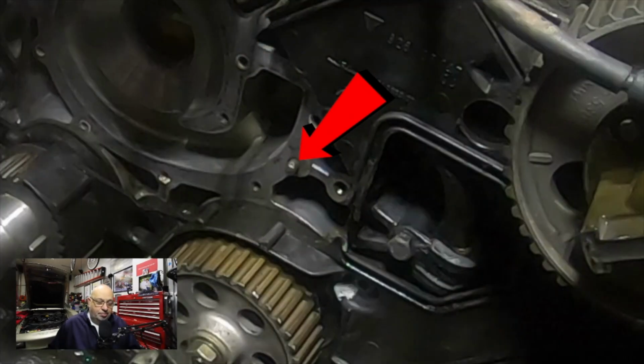That's one of the two mounting tabs for the water pump that holds the gasket in place and the water pump, so you can bolt it on. It's actually bent away from the pump. Now we had the theory that that was pulling the pump just enough away for the bolt that's closest to it not to line up properly. The other ones, there might have been enough stretch to do it, but that one is the closest one to it and probably was causing the problem.